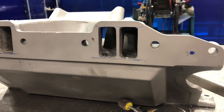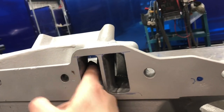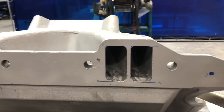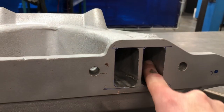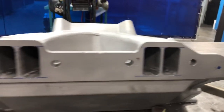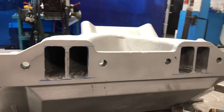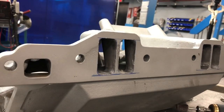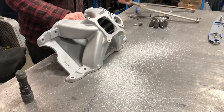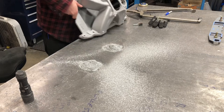This one side is done. Using this tool was a total champ — I could get way inside and really work that short turn radius. Look at that, you can see all the way up in the upper plenum now. Ton of material out, smoothed it all out. It was great for this corner too because this was almost a straight section right here, so I could really run it in and blend that area. That is way better than it was before. I am going to surface this face off and clean it up a little bit. One more side to do, then we can look at the top. Look how much material we took out of here — that's wild. That's all airflow.